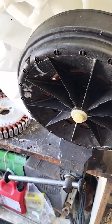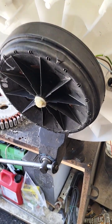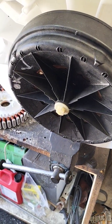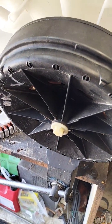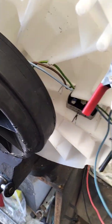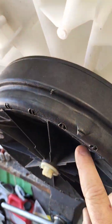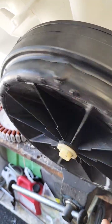Hey, Andy here from Aussie Homesteads. I'm just mucking around with a Fisher & Paykel stator which I've rewired. If you have a look on YouTube, you'll find a lot of videos on how to rewire a Fisher & Paykel washing machine to produce 12 volts. There is a bucket load of videos out there, so I don't need to do another one. But basically what I've done is I've taken this magnetic housing, and in behind there's the stator.